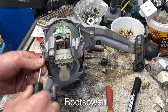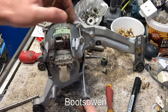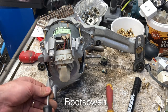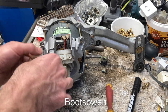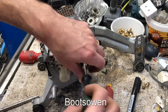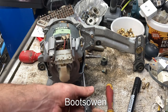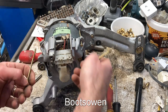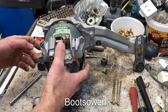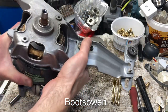You've got to be careful to bring these screws up equally and let them off equally, because you could snap one of the lugs off and you wouldn't be any further forward. If you tightened one completely and then tried to pull the other one in, you need to kind of bring them up in succession — the same with releasing them. You've got to balance the application of force when you're tightening and releasing them. Four screws — they look thinner than the Bosch ones. The tacho and all seems to be in this end. Let's see if we can get this end off first. Use the big screwdriver.